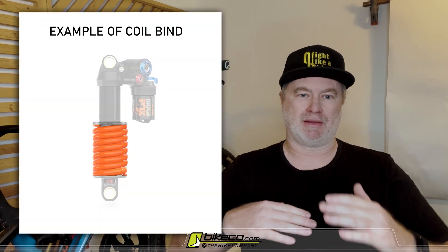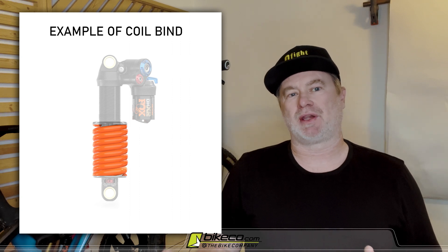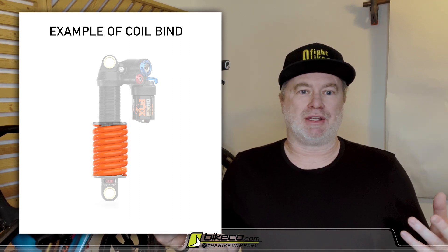You've got coil stroke — this is a critical one as well. The coil stroke, like your shock stroke, is a physical measurement in vertical travel that it can do. When your coil hits that maximum, it does what's called coil bind, where the steel rings actually sit on top of each other and the spring rate goes infinite — essentially the bike becomes a hardtail. In dirt riding we don't want that. You might hear about coil bind in some track cars or track motorcycles, but in our world coil bind is no good. So you want to make sure that your coil stroke is greater than your shock stroke, your damper stroke, including preload.